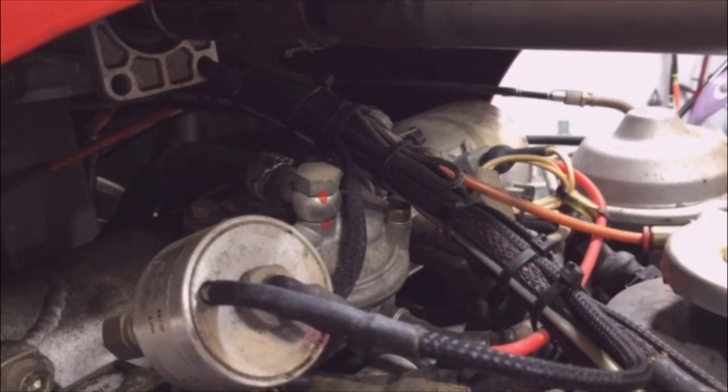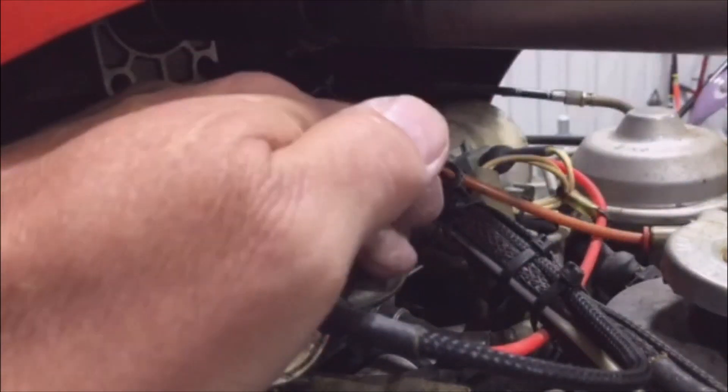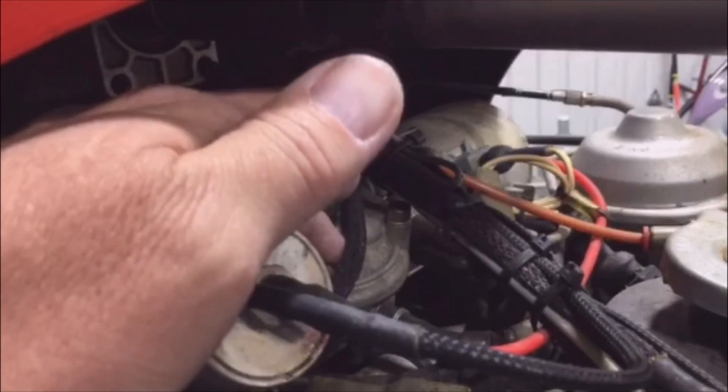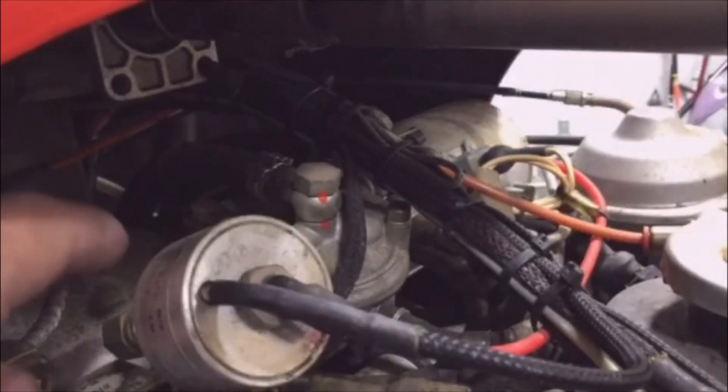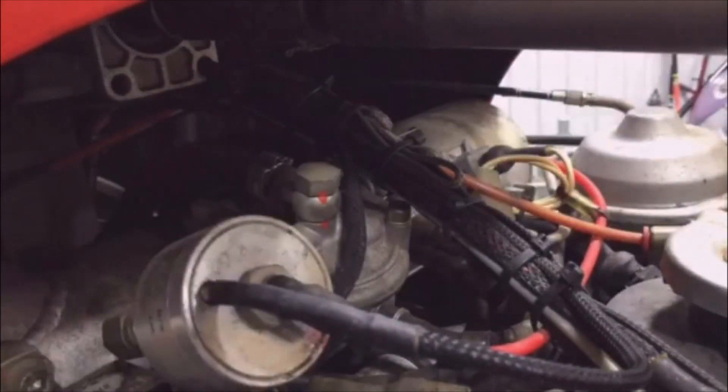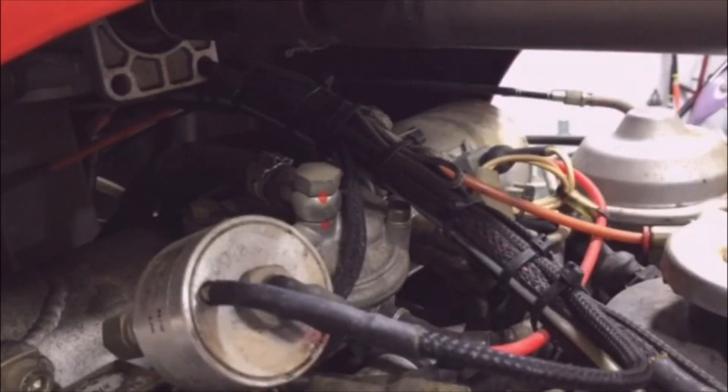Something I caught on pre-flight. This is a 914 Rotax, and this unit right here is susceptible — where the fuel goes in right behind the intake airbox — to ethanol. When I turn this on, you'll see it's going to start to leak.